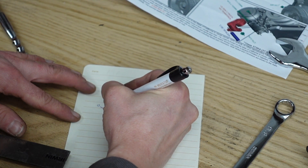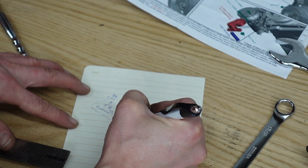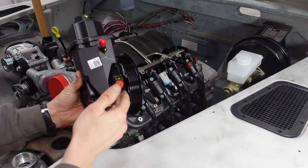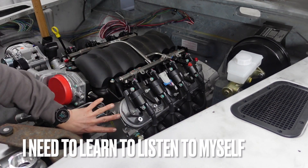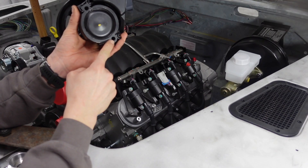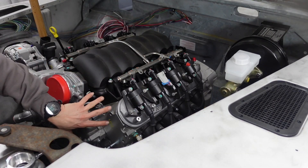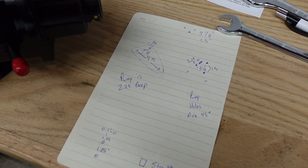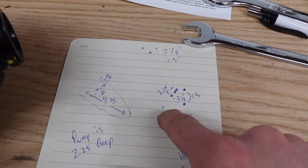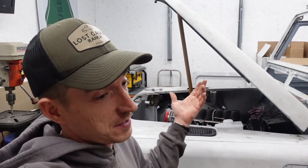So three and one-eighth up, three-quarter in — now we know where those holes are. We roughly figure the shape around that. We have two lines coming off this side so we need enough clearance. Something right like that looks like the ticket; it puts that hole directly beneath the existing one. Then we just need the angle of the cylinder head and we can draw up the rest. I've got my chicken scratch here — it makes no sense to anyone but me — but we'll go to the computer and hopefully be close. Good news: we have the 3D printer so if I mess up we just do it again.